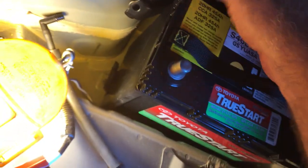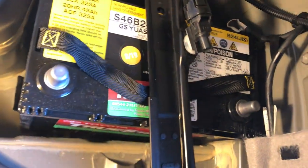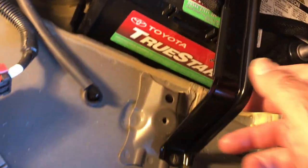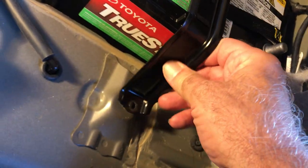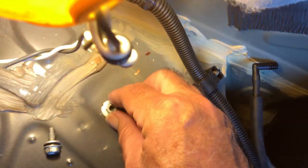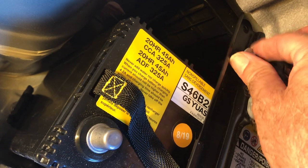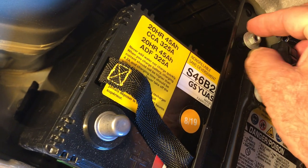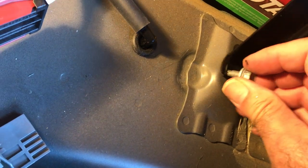The first thing I do when I put these batteries in is make sure the strap goes on. Put the strap on right there, put it in the correct hole — go back one notch. Here's the nut that goes on there — place that nut on, make sure it's finger tight for now just to make sure it all goes together. These are all 10mm, by the way.